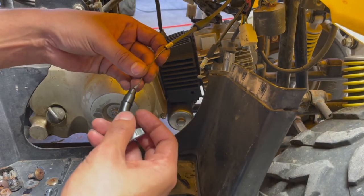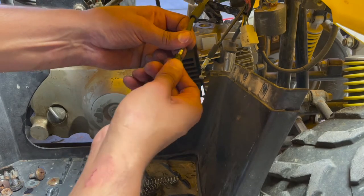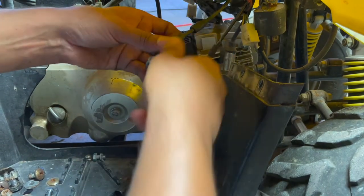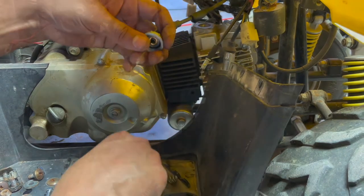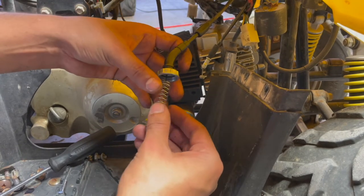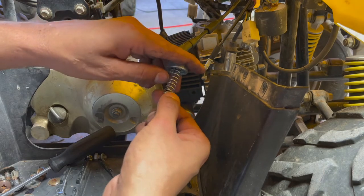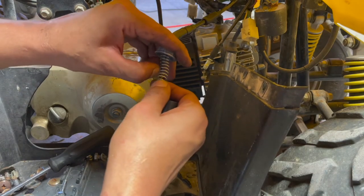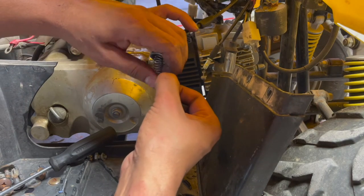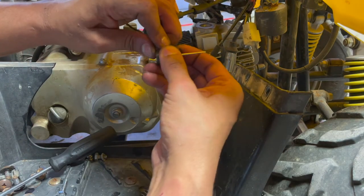The new one is this bad boy right here — it's really a plastic boot. The other one's probably better but I'm okay with this one, and it's new so I kind of want to use it. To reinstall: slide the throttle cable through the spring, compress that spring — it's a brand new spring so it's a bit of a pain. Then your throttle cable has to go through the bottom into that little hole that sits at the bottom.